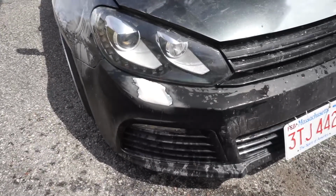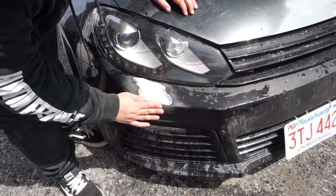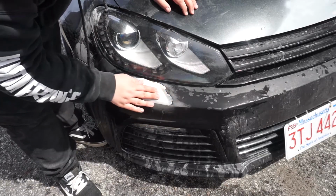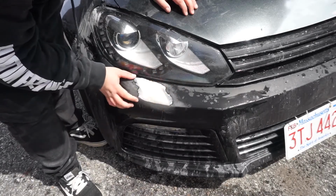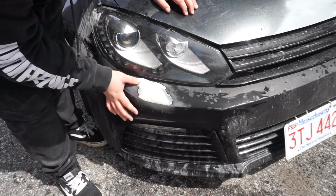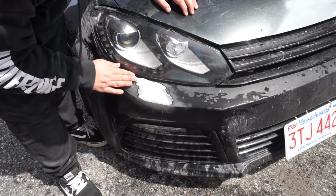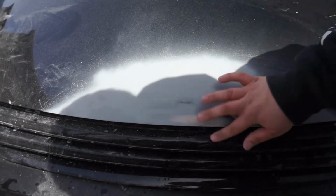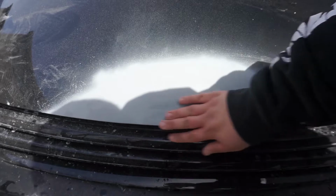The epoxy stuff is harder to sand down by hand, and I'm trying to still keep the body lines of the bumper, so I'm being extra careful with that. But still high around the edges, especially right here by the headlight. I'm going to take the bumper off. And this, honestly, this looks pretty good. Once I get to a nice fine sanding here, that'll be fine. I filled in some little pits that were in here yesterday. I did miss a few right here, so I'm going to add a small layer of Bondo here again.